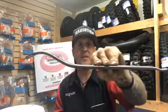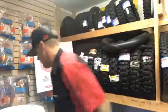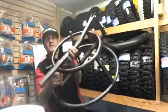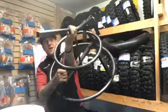Here I brought a couple tools. So this is my favorite tire iron for bibs. It's the Motion Pro 16 inch steel heavy duty one. Again, I don't have to have it in my pack, so I don't care how big and heavy it is. This, and then let me grab the stand. A stand like this. The most important part about this stand for bibs is this thing right here, because it's like a lever for breaking beads and doing things like that.